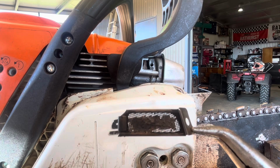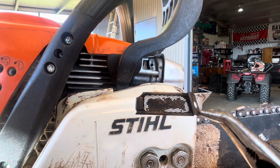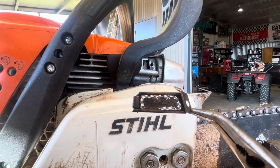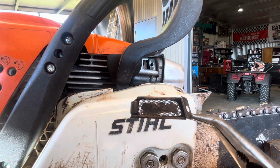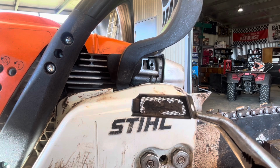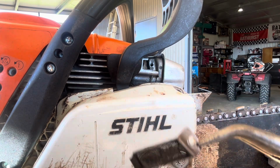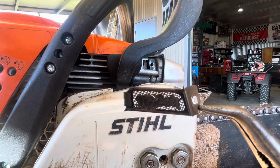Half block with carbon. Not much airway getting through there, exhaust getting through there. It's blocked, it's not breathing properly. So, one or two things, you can just scrape that off with a screwdriver or burn it off with a little blowtorch or something. So I'll do that. And we'll put him back in and we'll see the difference.